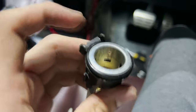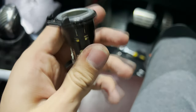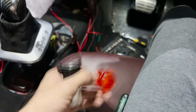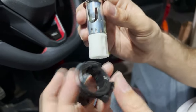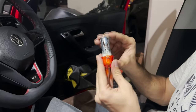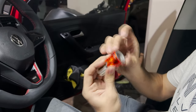The older ring is a little rusted and a little bent, so I'm not going to use that one — I'll just use the stock one. To remove this plastic trim there are two locks: one right here as you can see, and the other just opposite to that. You just need to push that in and it will slide right down. Then you can just put this back on and slide it on, and just like that you can remove the old non-illuminated trim.